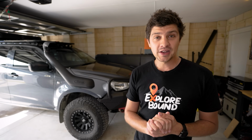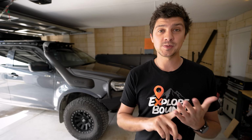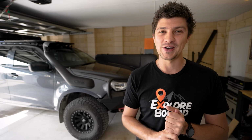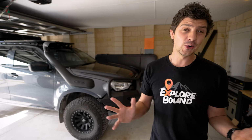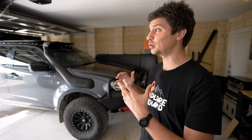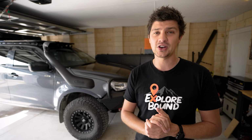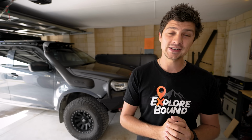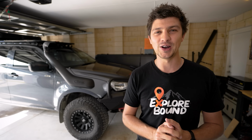It is also worth mentioning that you can improve the issue with a specialised wheel alignment or by installing some aftermarket upper control arms, but the key word there is improve rather than rectify. So I suppose my takeaway from all these numbers is that if you've got decent four-wheel drive tyres and you're planning on keeping your vehicle long enough to go through a couple of sets of tyres, then it's definitely worth the money for the upgrade, both financially because you will eventually offset that cost of the upgrade, but also just for the general drivability of the vehicle.